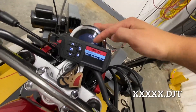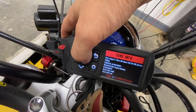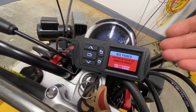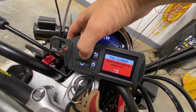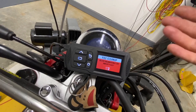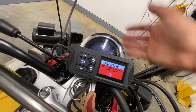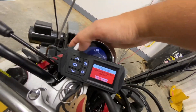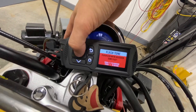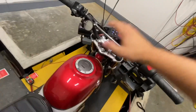With the tune loaded into the PV3, we can go ahead and flash that file downloaded from the computer into the bike. As you see, it says 'not paired' — this is the first-time pairing process when this ECU is connected to the PV3. We're going to hit accept, then delete all incompatible files. That means if there are any other files on there for, say, the Grom or 110, it will delete those, leaving just Honda Monkey files unless you add more. Hit 'Flash ECU with selected file,' hit yes, and now we're on our way to having a spec map for this bike.